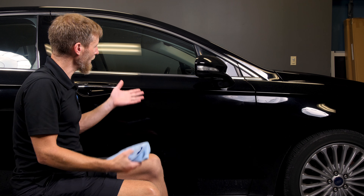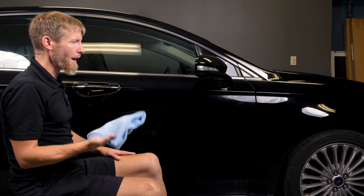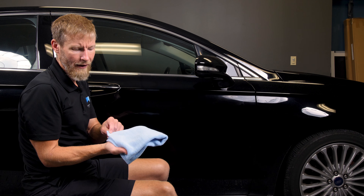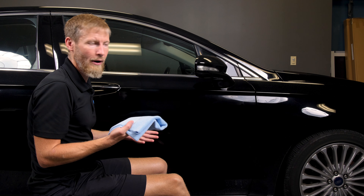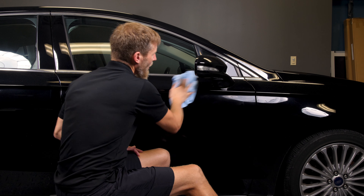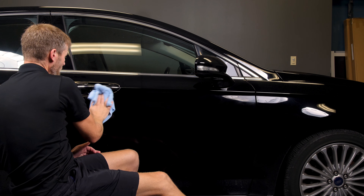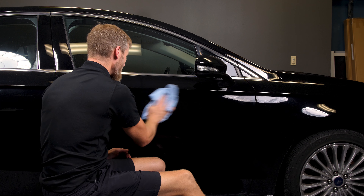What you're looking for is a bit of a haze. When you go to wipe this product off and wipe a little bit, it shouldn't just smear around and look oily — if you put a light on it, it should be a dry haze, and that's what we've got now. For wiping off, you don't want a long-nap towel — you want something like a Microfiber Madness Yellow Fellow or a CarPro Two-Phase towel, something that's a few hundred GSM with a shorter nap, but obviously an edgeless towel and high-quality microfiber that's not going to scratch your paint. Keep the towel flat with even pressure and it really wipes off nicely — flip the towel over for a final wipe and you're off to the races.